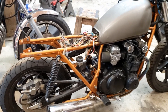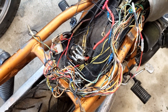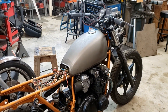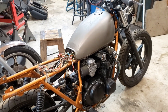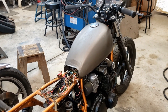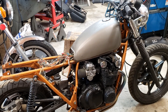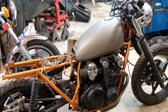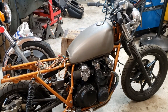I had looked at all the wires and gone through them. There's hardly any fuses, so I checked those out. I have a 10 amp slot with a 9 amp in it right now — seems to be working okay. Today I put the new coils on and you got to hear it run for the first time. Earlier today — not in the video — I did let it warm up for probably 10 or 15 minutes, turned it off, started it, ran perfectly. Pretty sure I've got that figured out finally.